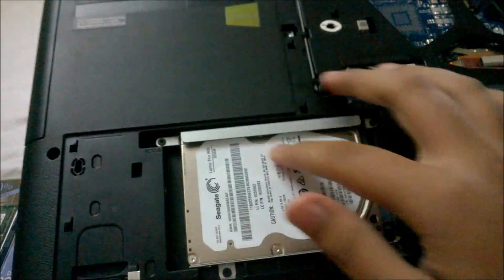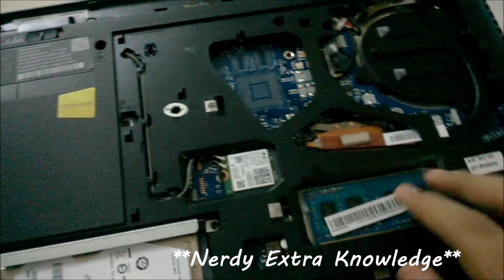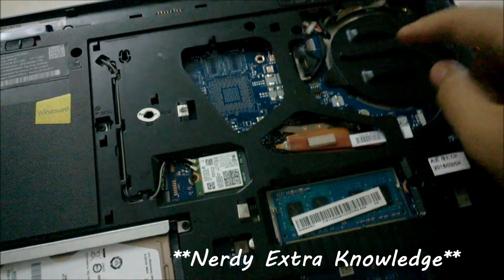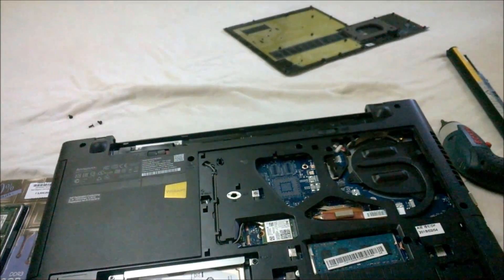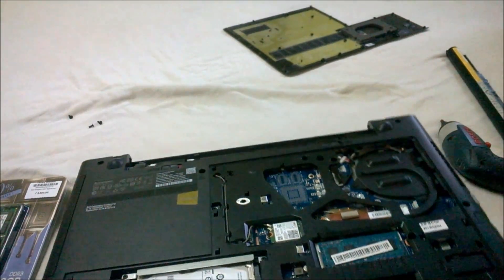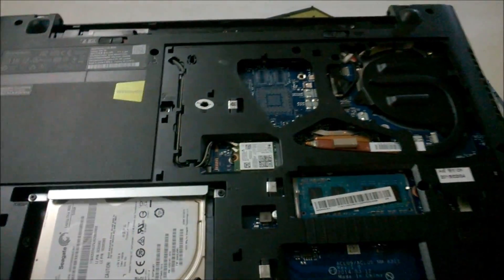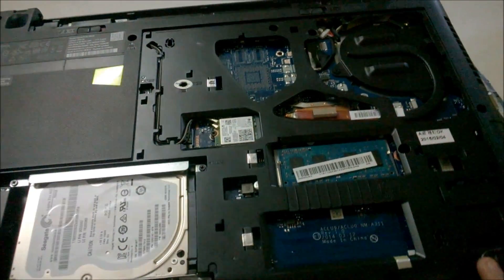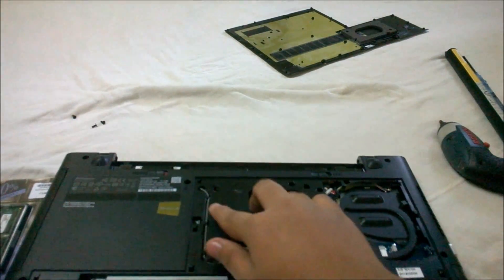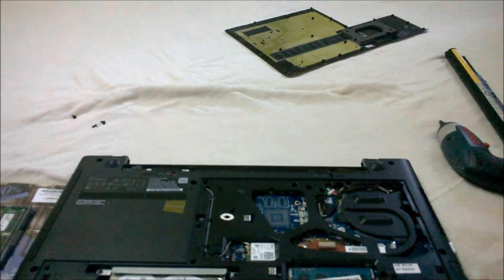Here as you can see, this is the hard drive — it's a 500GB hard drive. Here is the RAM stick. Then there's a Bluetooth adapter. Here we have the processor, and this is the heat sink. Some might have the doubt that upgrading RAM is going to ruin your warranty — no, it's not like that. According to Lenovo, the RAM is a CRU, a customer replaceable unit, which can be replaced by the customer without voiding the warranty. But you can void your warranty if you open the screw that has a seal over it, such as trying to change the processor or the heat sink.